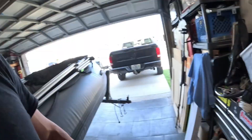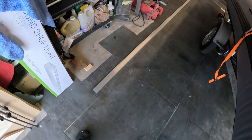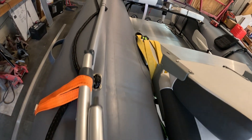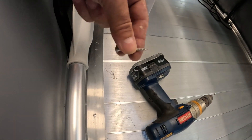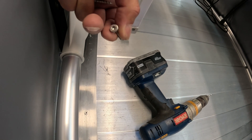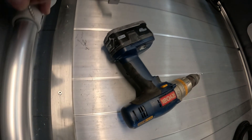The humidity is intense. So like I said in a previous video, I wanted to get aluminum box tubing — 1 inch by 2 inch — and run spines from front to back of the boat. That is exactly what we're doing today, running them all the way down. I got from Home Depot max stainless steel star drive, inch and 5/8 long screws.